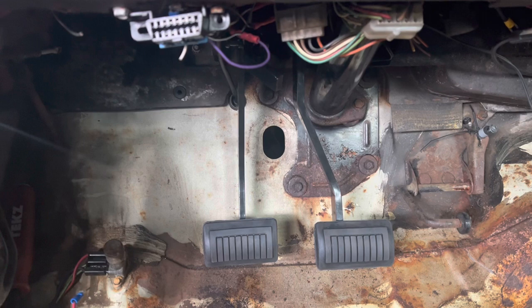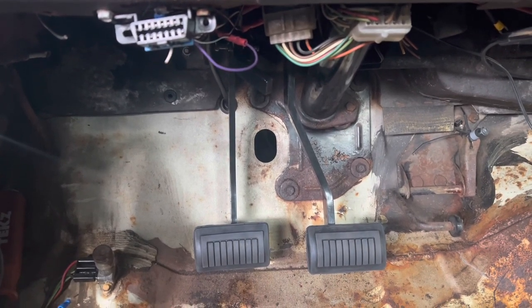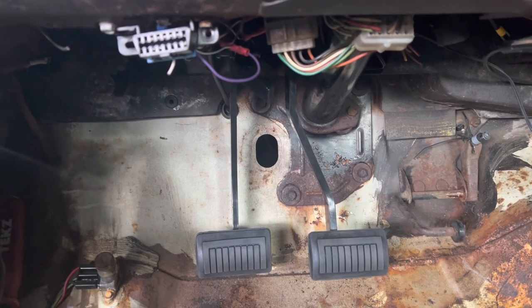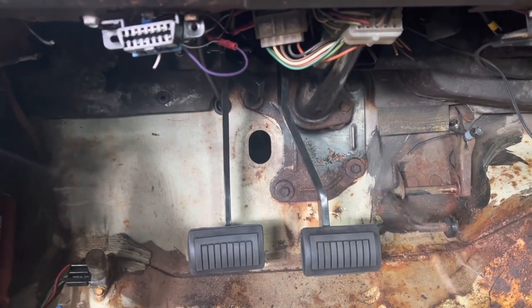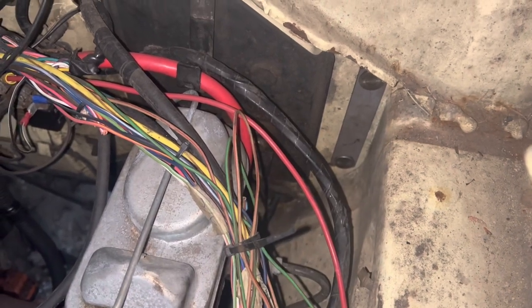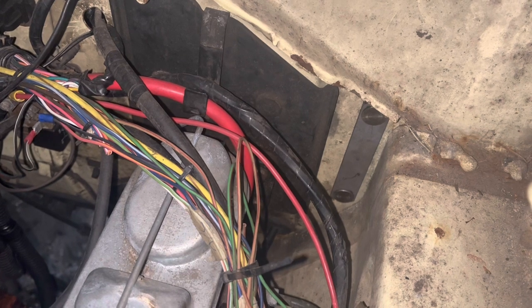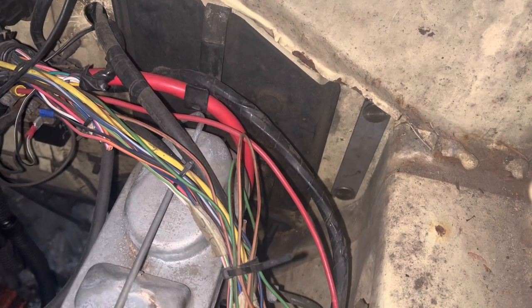The kit fits pretty well, although I can't quite figure out where the bolt and the brace is supposed to go — there's no hole there. Time to break out the welder. You can also see here the brace that goes on the outside to back up the firewall to keep it from flexing every time you hit the clutch pedal. I actually got one of these separately, but Brewers also included it in the kit.